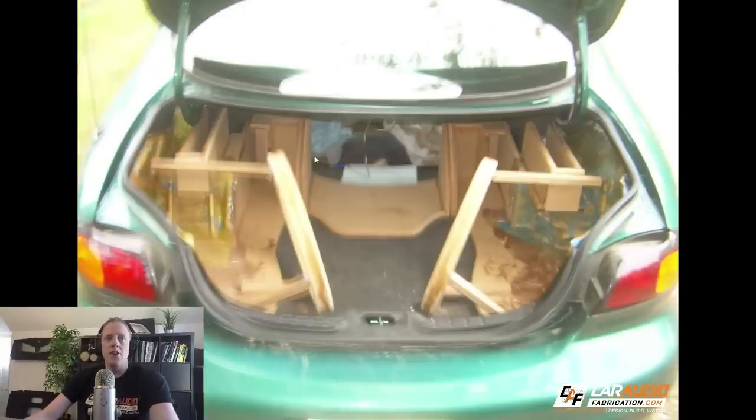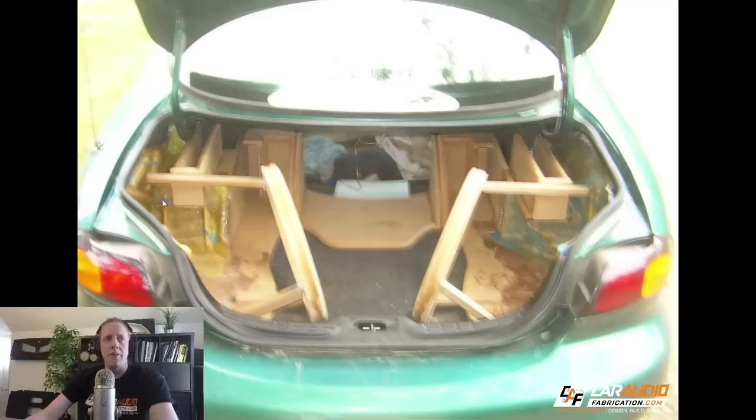I added this center location piece for the amplifier rack, and the two just butt up against each other. I also added some dowels, because flat fiberglass can be really hard to get strong unless you put down a ton of layers - what really adds strength is having some curvature. I intentionally added those dowels after a couple of layers and secured them with tape; nowadays I would use CA glue. Rather than using dowels, I would now recommend fiberglass rope, where the resin sinks into the rope and makes it nice and strong while creating a curve to lay your fiberglass mat over.